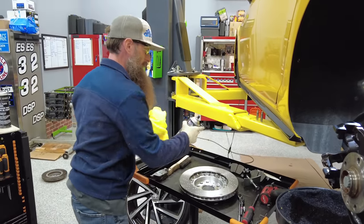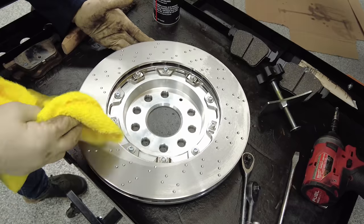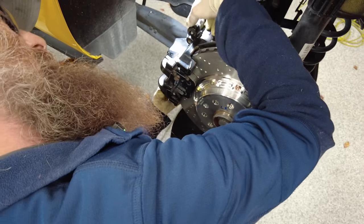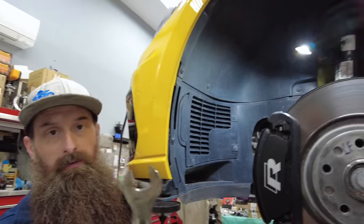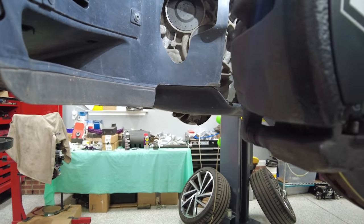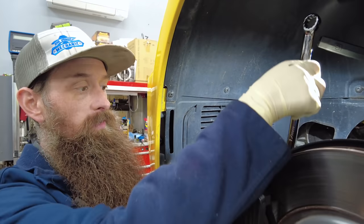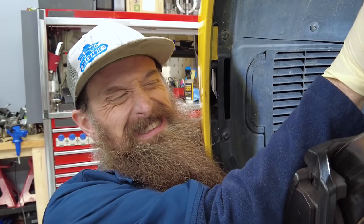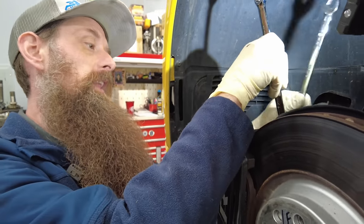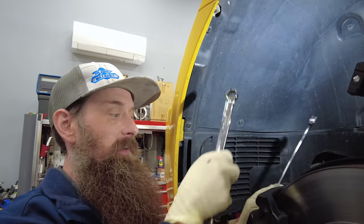Let's get it put on. We also want to make sure we clean our rotor. As always, check out how dirty these actually are — they look clean here but look at how dirty they really are. These are a pretty fresh two-piece rotor. This is my stage five cut-down wrench so that it fits on the caliper carrier and we can get the bolts off. These on the front of this car are a lot like the older Volkswagens' rear that you had to counter-hold.